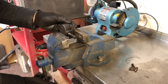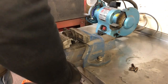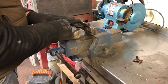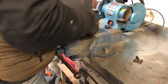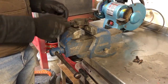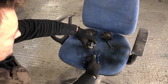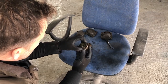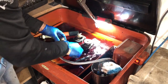I've stuck a nut over that so I don't damage the bit that holds the brake pad in place, then compress it in the vise. That's been stuck for quite a long time. By putting slightly longer bolts in here, the penetrating fluid is now getting to the point where you start to work it — it's now rotating where it was completely stuck fast, so the piston's stationary and the piston carrier's going round and round. There we go — filthy old piston, all needs a good clean up. There's the seal. I've got all four apart now so I can give them a good clean, degrease and actually determine what kind of state they're in underneath all the grime.